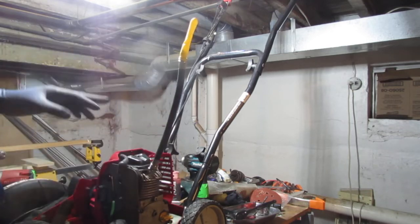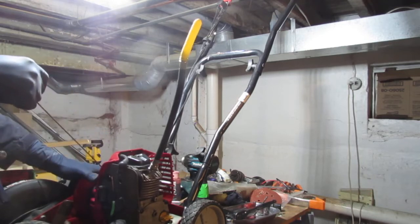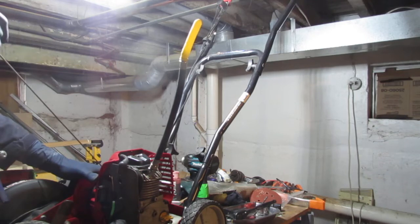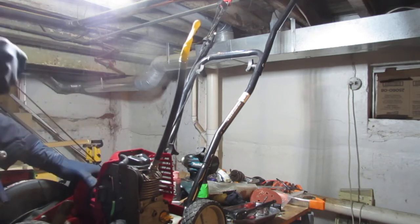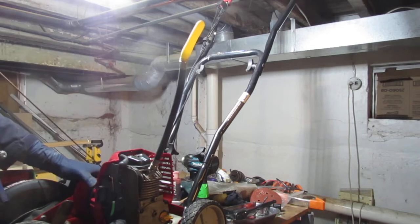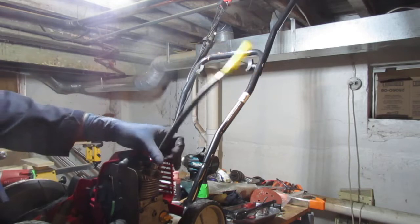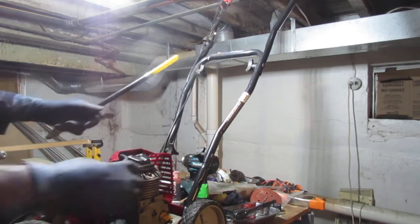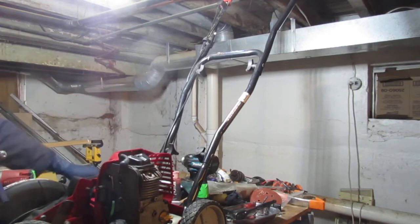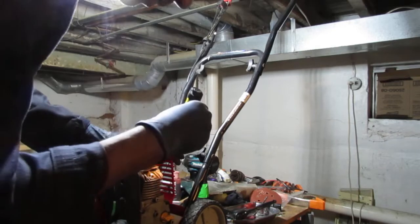So you watch the balloon. Right, we want it to just pull on the pull start, wait for it to be blowing up. Oh, see, it's going down again. So that would be your compression stroke right there. So at this point, right, you can kind of look into there now and see what's going on with the piston.